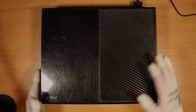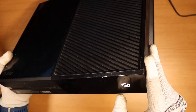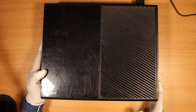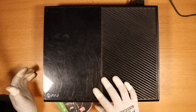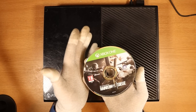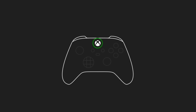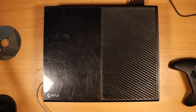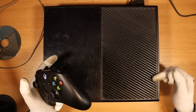Moving on to number four. I'm sure we have the same sort of deal here — does it turn on? It does power on. I'm very shocked. Do we get a display? Yes, we do. We have a disc — Rainbow Six Siege. Get in. Hopefully we get a boot to the Xbox home screen — and there we have it. I reckon they maybe had a dodgy power supply, so they listed it as faulty saying it doesn't turn on, but it's fine. The fan is making a little bit of a noise, so I'd like to give it a good thorough clean.